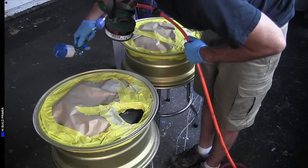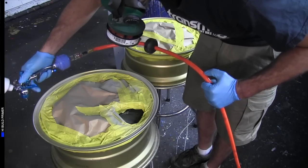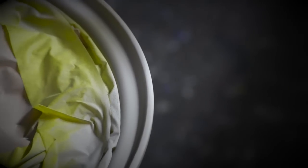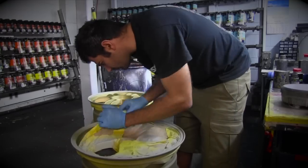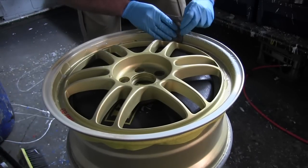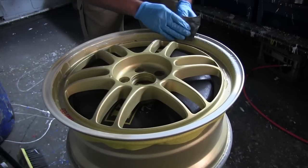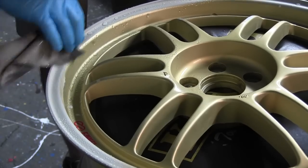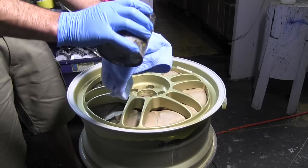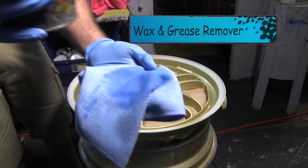Now you want to spray 3 coats of primer, waiting 10 minutes between coats. Okay, now that I've left the primer dry overnight, I can start sanding it with my 800 grit wet sandpaper, spray some water on there, and that's going to make it extremely smooth, and then I'll be ready for my base coat. Now I'm going to clean the wheels with wax and grease remover,